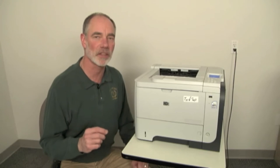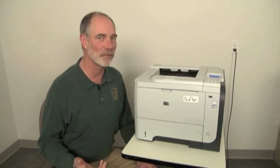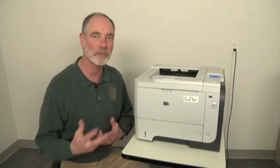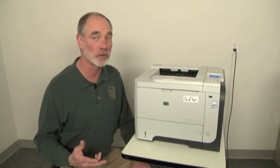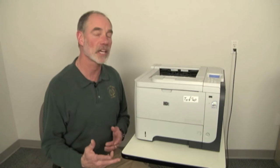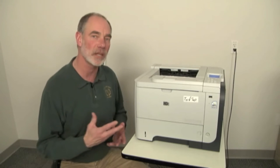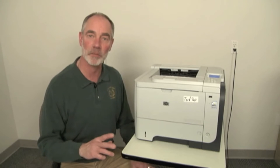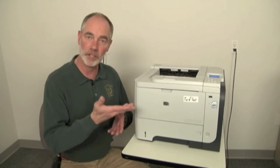The stop test is something that is commonly forgotten about in the industry. For those of you who have learned about the stop test or halfway test for checking image defect issues, and for those who haven't, it is a great test for isolating where an image defect is coming from. The primary focus tends to be between the toner cartridge and the transfer section.